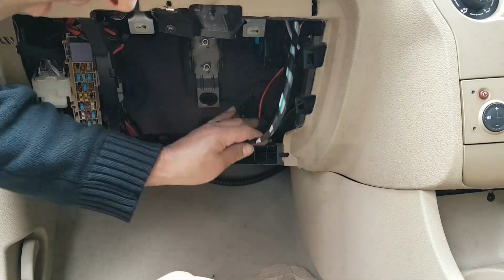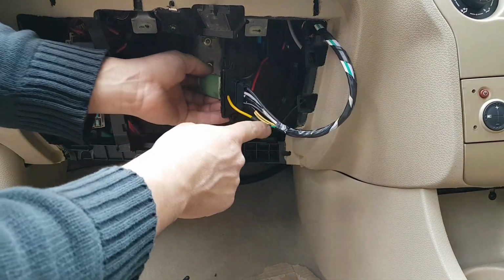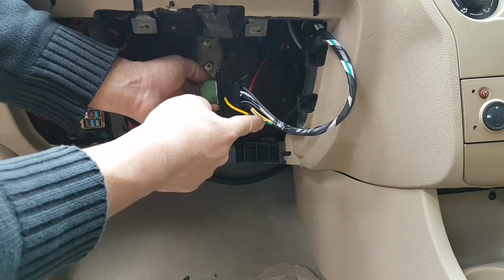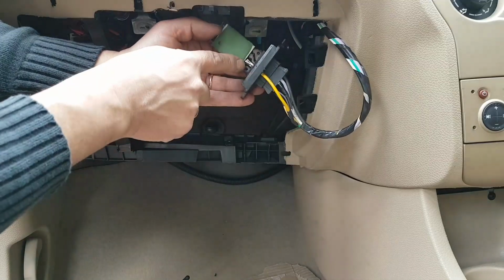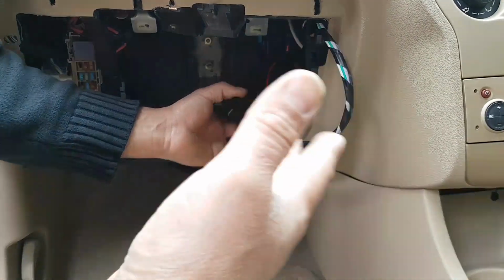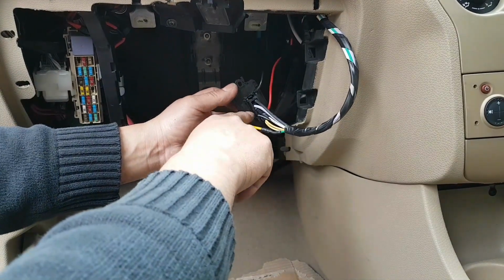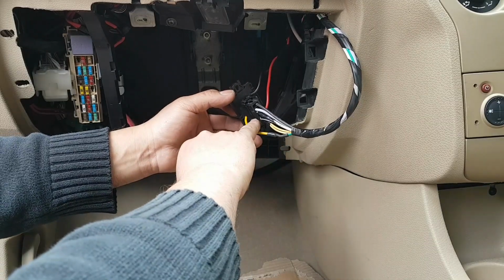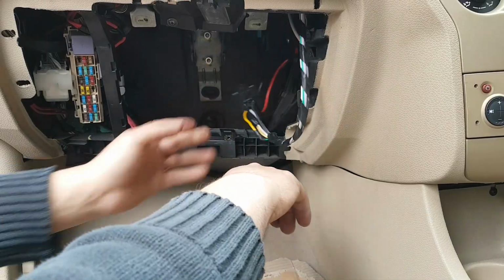Guys, let me show you what I've done. So what I've done is I've bypassed the green wire, obviously it's yellow here, but it's all soldered through here, drilled a hole and soldered that straight into the pin inside. Okay, so the ideal repair would obviously be a new plug, because this socket here is gone. It would have to be a new one, and obviously redo this wire as well, but I think it's going to work. Let's try now.